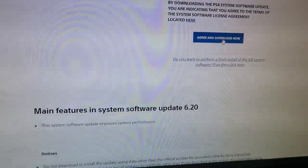We've still got 100 minutes left on the backup. Basically, once this is done we take that USB stick out, put it in the new one, copy everything back over — which takes another couple hours — and then we should be good to go. But wait, I was wrong — there is one more little problem: we don't have PlayStation software on that new hardware. There is a hard drive in there but it doesn't have anything to boot. So we need another little USB stick. What we're going to do is download the system software, drag it over here. This is done — we're going to take this USB out and plug this one in. Where are the USBs? They're always so hard to find on these. I think we're in there.